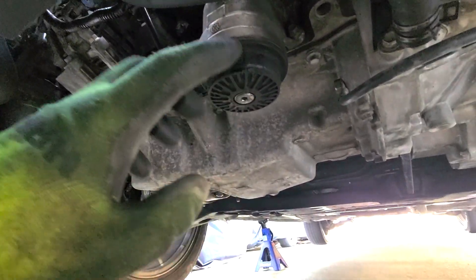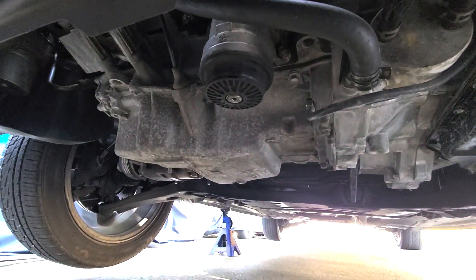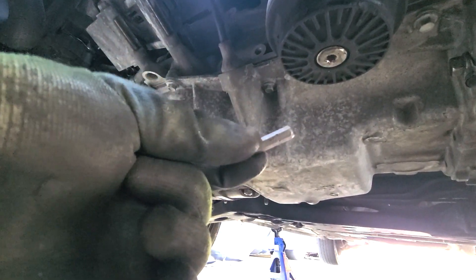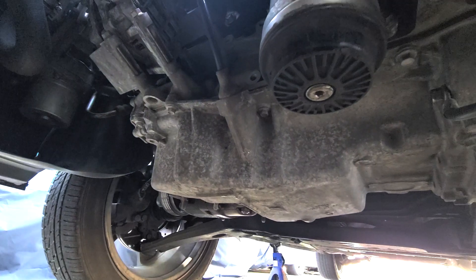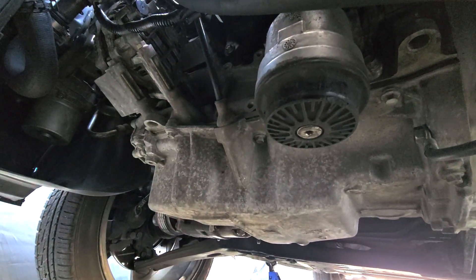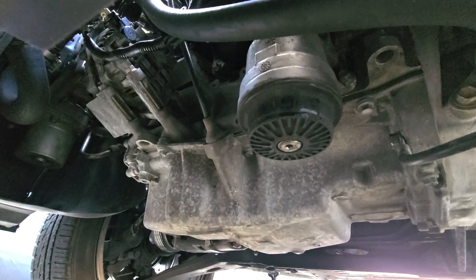Now we're underneath the car. There's a plastic cover that goes all along here — it's held on by 10 or 12 millimeter bolts. You'll have to take that plastic cover off. I've had it off for a while. Your oil filter is right here, right in the center of the vehicle. It's a little more unique because you have to use a bit that's the right size — I'll list that in the description. There are two ways to do this: you can use that to drain it only, or if you're careful you can grab it and turn it counterclockwise, lefty-loosey, to pull this whole plastic unit off. The problem with these cars is this plastic — if you hit it, all your oil will come out and you'll seize your motor.